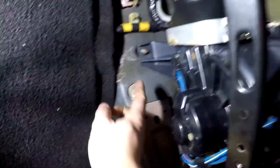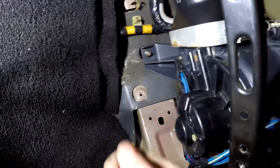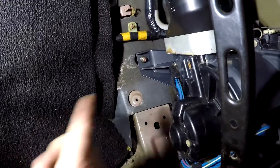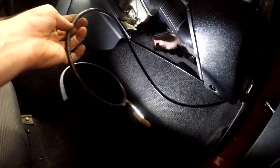We're going to go inside the car now. It's going to be a little difficult to see, but take the glove box out obviously. If you run it through that hole — it's going to be so hard to see. See where your blower motor box screws in right here? It's secured to the firewall. You've got to reach your hand up in here and you can sort of feel where it's at. All I did was I took a Phillips head screwdriver and just jammed it through the hole, then came in here and stuck my hand up in there to feel where it was supposed to come out. Then I took the screwdriver out, shoved the tube through it, and ended up having to grab the tube with some needle nose and pulled it through. Now you can see that the rest of our tubing is just chilling in the interior.